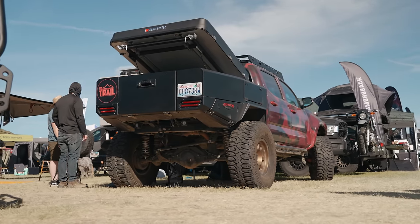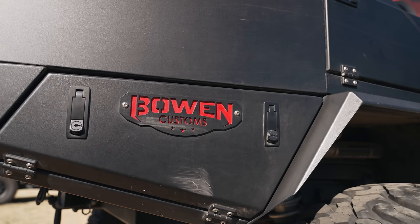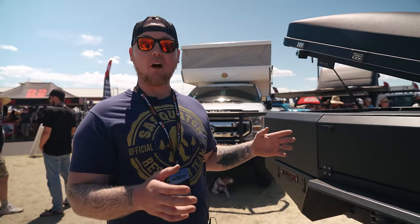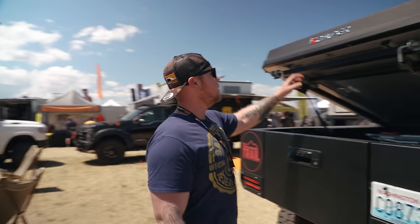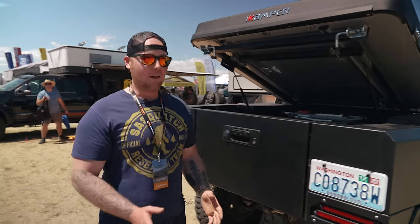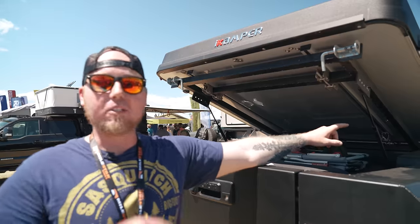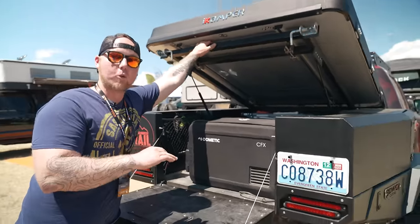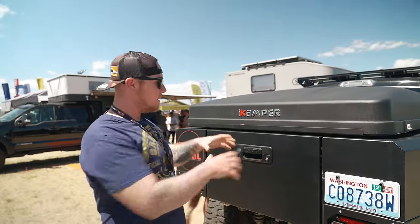The most exciting part is the back — it doesn't look like a Tacoma anymore. I worked with Boeing Customs and we wanted to build something truly one of a kind. I chopped 18 inches out of the frame, made my own cross member, and then went to Boeing Customs in Colorado to attach this bed. The bed is 280 pounds because it's all aluminum, and the tent for the camper is only 125 pounds. Overall it drives exactly like a stock truck, but with all the extra clearance. Brent and I went back and forth on this — it's based on an idea from my one-ton Dodge where I put a rooftop tent on a rack that lifts up the same way. The tent keeps the center of gravity nice and low and essentially acts like a tonneau cover.